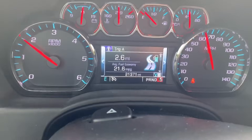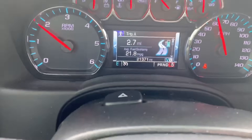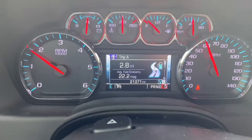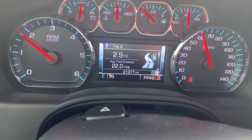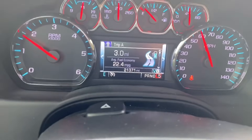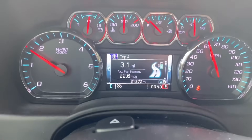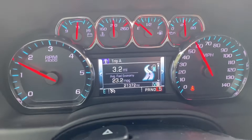That is a very quick, easy tip. These little how-to videos grow and help people over time. I feel so stupid for not reading my owner's manual after having this truck for several months and not looking to see if there was something in there about not using active fuel management. It literally says: in town towing, if you go into L mode — L5 or L4 for heavier pulling — it doesn't enable.